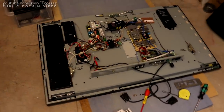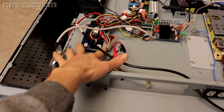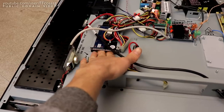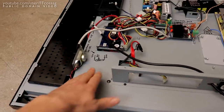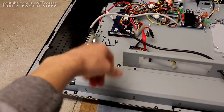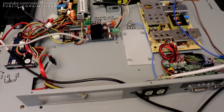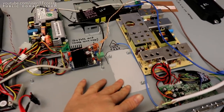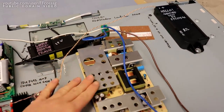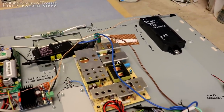I do have a bit of a plan of action. What we're going to be doing is first get rid of the hard drive cage here, because that's interfering with the heatsink. Once we have that out of the way there's nothing in the way of the heatsink. We also have a bit of a hole underneath which will allow the heatsink to draw a bit more air. We're also going to have to cut this mount out and move the power switching board — a homemade board which serves as a monitor power-on board. Originally this device had no means of turning off the big power supply for the 42-inch monitor; it was powered on all the time, drawing about 10 watts just sitting around.